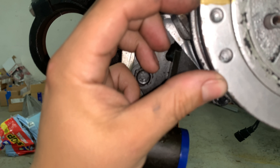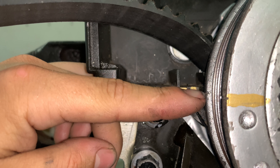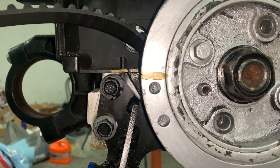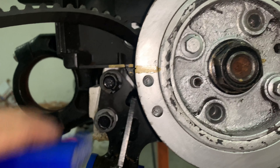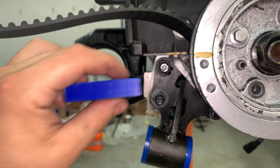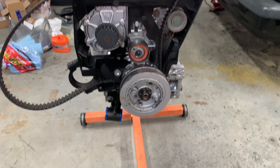There's this little slit right here on the crank pulley that lines up perfectly with a mark on the cover — I wonder if that's Volvo's true top dead center cylinder three marking. It's kind of hard to tell from the video, but it's pretty close. I'm going to double check it one more time and make sure the top of the mark aligns with the top of the gold mark and the cam cover mark I made.